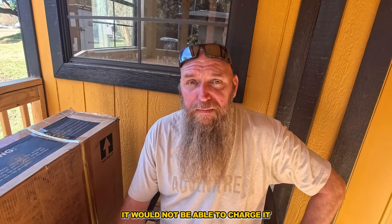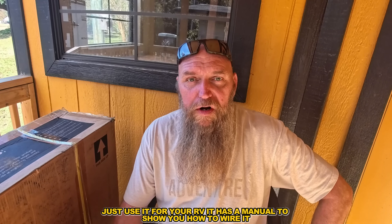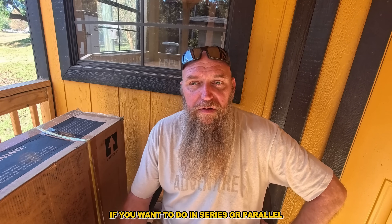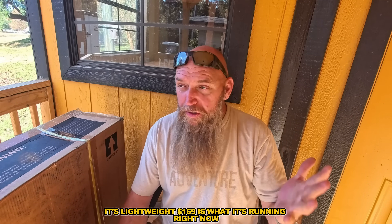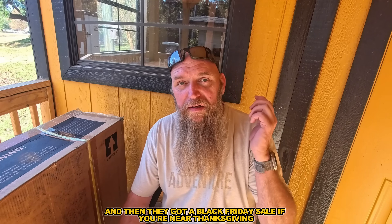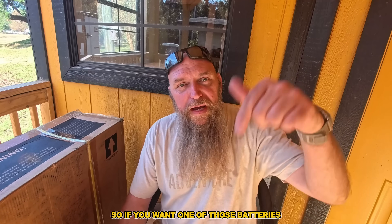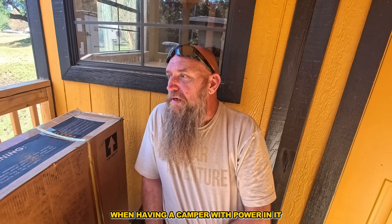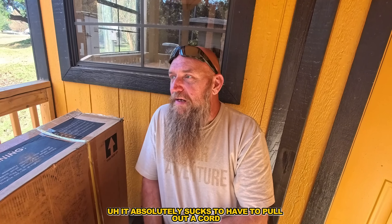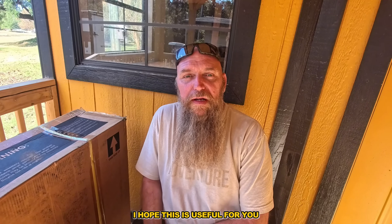The pros: it's a LiFePO4 battery with a typical lasting charge cycle of 3000 to 5000 - a lot longer than lead acid. It's lightweight, which is absolutely a shock to me how light it is. Some cons: returning the battery is restricted - the carriers don't like it. The temperature is limited - cannot be charged below 32 degrees Fahrenheit. The product must be carefully managed; improper use will void the warranty. Overall it's not a bad battery - I don't mind it at all. It's lightweight, $169 is what it's running right now, and there's a Black Friday deal near Thanksgiving. The LiFePO4 model is just a better battery. I'll put links below for the battery and the box. It's very simple to put in and makes such a difference having a camper with power in it. Thanks for watching guys!